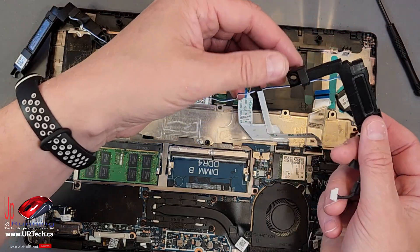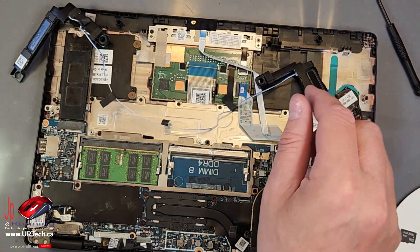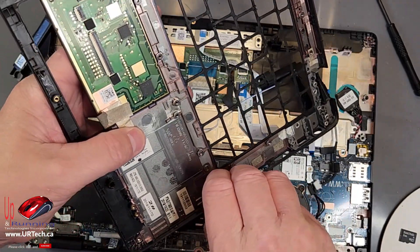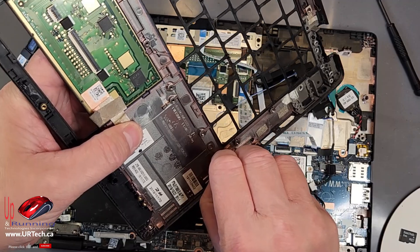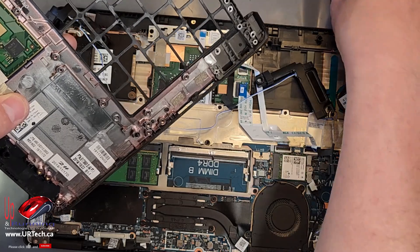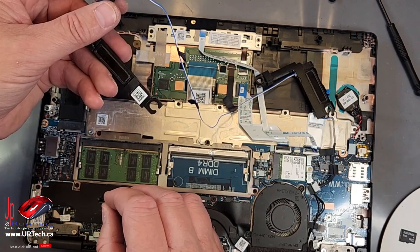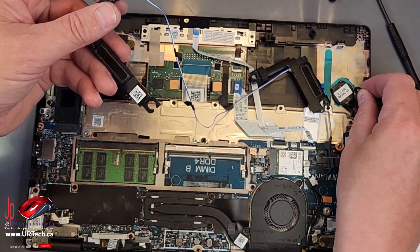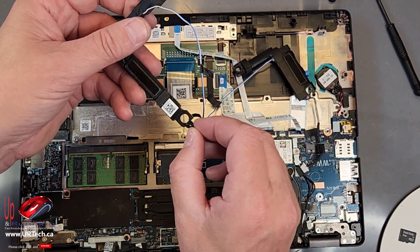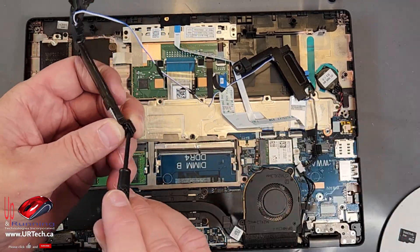I see I'm missing a little rubber gasket — there are actually two of them. There's a little trick with these: pop the rubber gasket off the old mount post. Now it's simple enough to just put these on the post, but if you do they'll just get squashed down. You don't do that — you put the rubber gasket on the speaker itself instead.